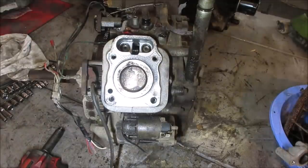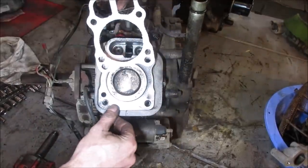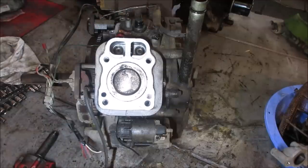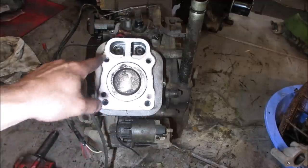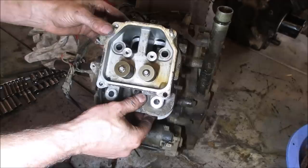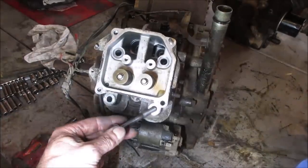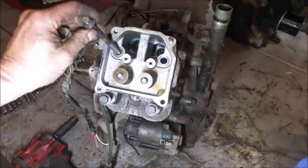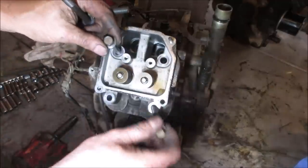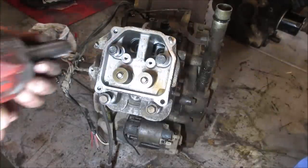All right, let's go get our painted gasket and put it back on. The piece that's missing is right there. I'm going to go take the head bolts and clean them so that the threads aren't all rusty. Probably should have hit an air gun down the threads too, just to clean them out. That's not where they were. But the rusty ones where the rust was, clean ones there. Let's just run them in with the gun. We're not going to torque them down with this.